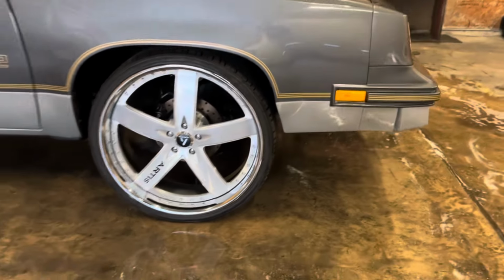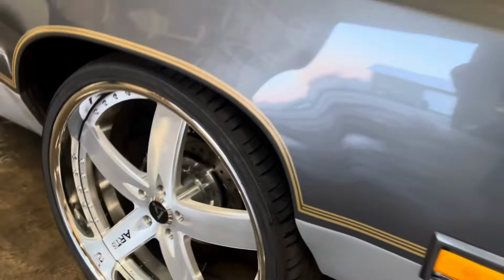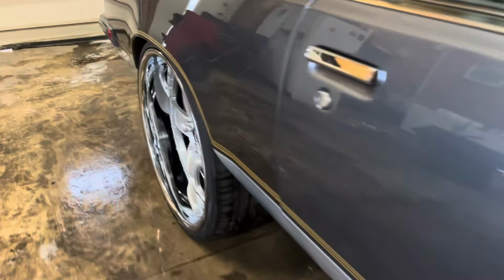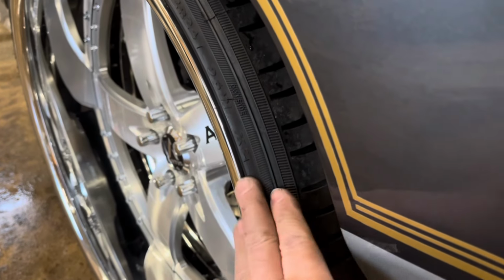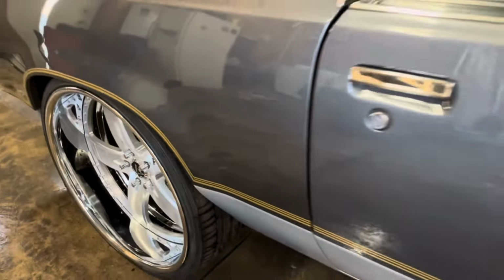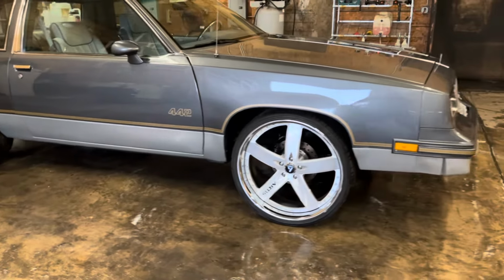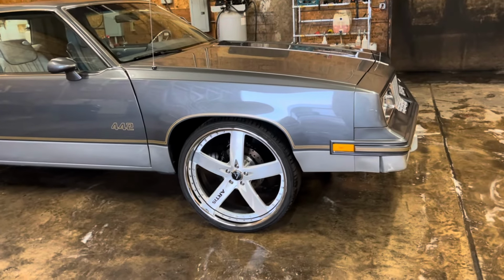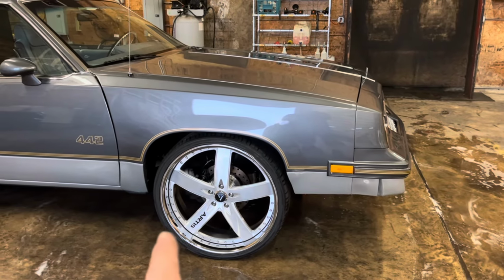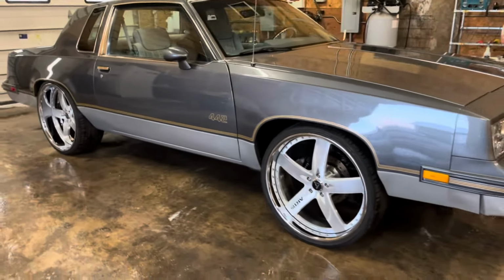Too much forward. This tire is a fatter tire. Like I said, that's all I'm saying on the rims. When you look at that tire, same tire as the back, front rim's a little skinnier, so it's squared up. Then if you look at the back, you can see that the tire is in a little more because the rim is fatter. So, you know, it stretches it. So the front of this car, if you wanted to do this style, you go with a 255/25/24, which is a way smaller tire, and it would keep you from having to cut the fender as much, and it would clear more, and you could ride a little bit lower on the front. Still would need a sport steering, stuff like that.